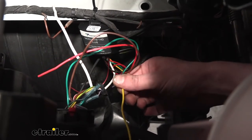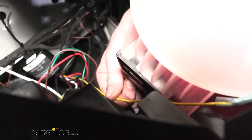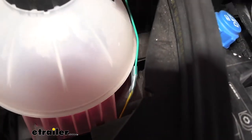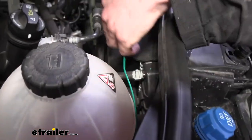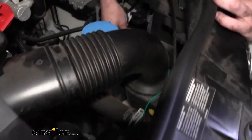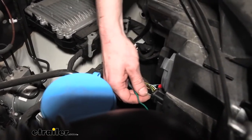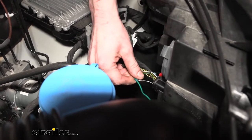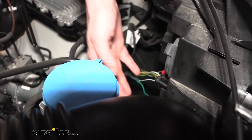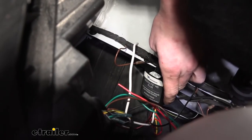The green wire here goes right over to our connector. Our factory connector is where it comes out of the taillight. We hooked the green wire in-line with the black wire with the gray stripe — that's the pin furthest toward the outside of the vehicle. We cut the wire, stripped it back, and put a butt connector on it. Our brown wire was connected on this side to the gray wire with a red stripe — again we cut, stripped, and put a butt connector on there. The yellow wire on the module is short, so we cut off most of the long green wire after connecting it and used that excess to extend the yellow wire over to the driver's side, tapping the same pin — a black wire with a white stripe on that side.